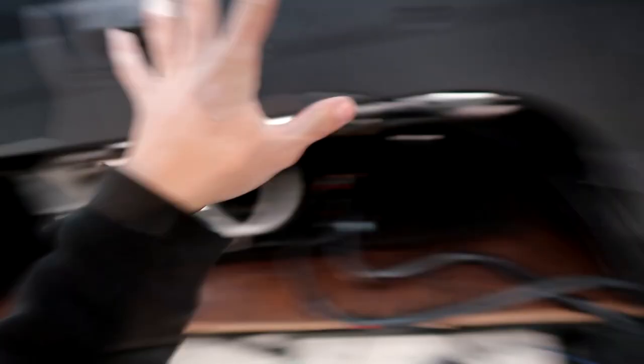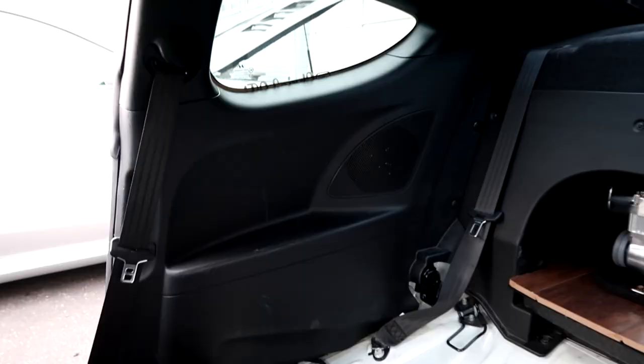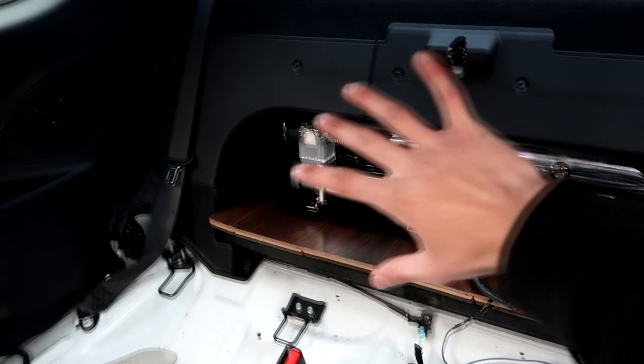Don't mix up your positives and your negatives or else it will not work. Now this is all done, tuck is right in there, speakers on, same with that side. Now I have to put all the panels back on, which is not going to be fun. Once the panels are back on, you want to go ahead and put your seats on in the same order that you took them off. The side panels are not easy to get in at all, so you need a lot of patience. Start from the top, make sure it's jointed properly right here and that's in first, and then just work your way down. Once the sides are on, go ahead and put the seats back down, put that bolt back in, and put the side guys back on with the two bolts on the sides.